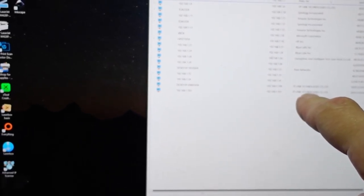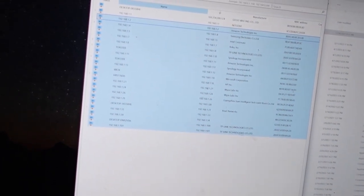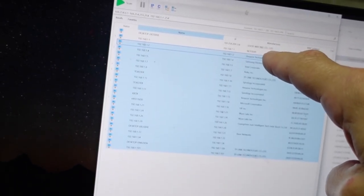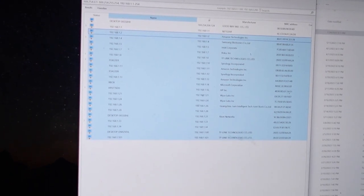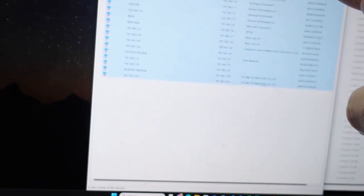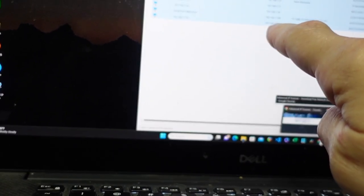I have TP-Link Technologies showing up. One of these is showing up as my desktop, also showing up at a completely different address — 169.254.209.124. I have no idea what that is. Made by Good Wave Industrial Company Limited — I'm not entirely sure what that is. I don't know if that might be the fiber modem from the ISP. A lot of the rest of this stuff is stuff I know is on there from the wireless. But these two — 192.168.1.100 and .101 — 101 should be the router, because right now the router is the only thing on in that stack. If you notice, it went from 192.168.0.1 to 192.168.1.101, and I have no idea why.